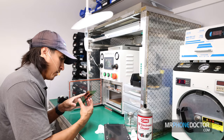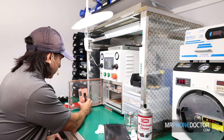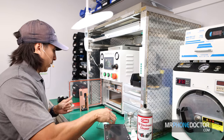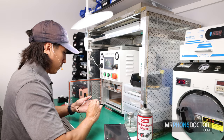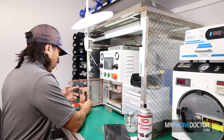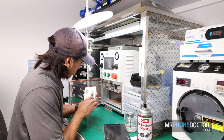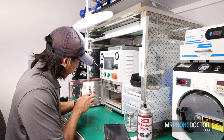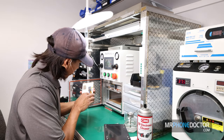This is the magic mold that we're going to be using. It's a nice, tacky, spongy mold. There, that looks good. So I'm going to gently prop her up right here on her flex, so that is safe there. I'm going to reveal the OCA, and we'll do the manual alignment here. So we like to start from the top, and just make sure that this punch is lining up perfectly.